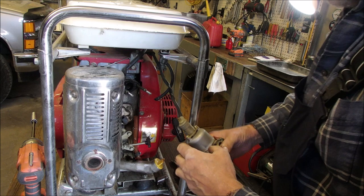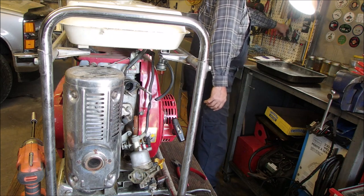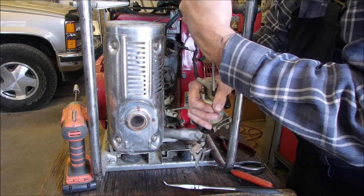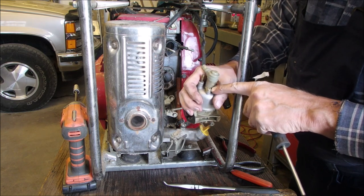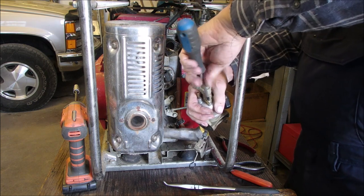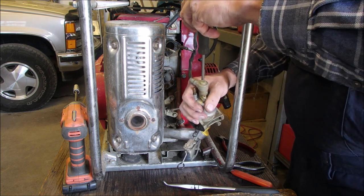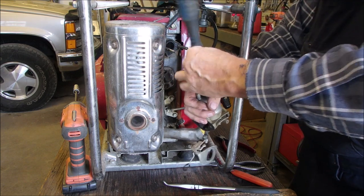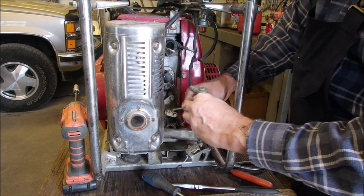There we go. Well, I'm going to get a Phillips screwdriver to get that bowl off of there, I guess. Then we'll have a look underneath it. So now I'm just taking the bowl off this carburetor. And these are Japanese industrial standard screws. They have a dot on the screw and it's a special screwdriver. These screwdrivers work great on Japanese stuff, and they work good on SAE, but the SAE Phillips screwdrivers don't work that well on the Japanese because of the depth of the cross.